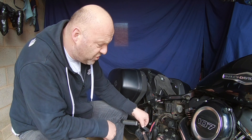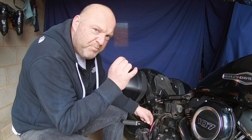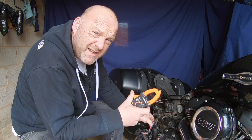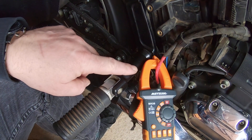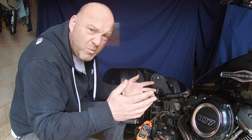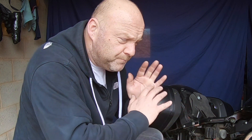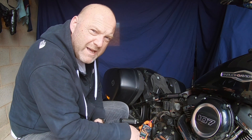As you can see I've unwrapped the sheathing and exposed the red wire. Be very careful — just feel where the wires are, make a very small incision and then try to unwind it. There are a couple of other small wires here so you don't want to nick those. Now get your clamp meter, separate the positive wire from the rest, and slip the positive wire through. To achieve 13 volts it really depends on what bike you have, so I can't give you a specific RPM — just use a multimeter across the battery and that will determine it. For all the battery voltage tests, watch that other video. On the website, on the Harley Parley page, there is a free PDF download of all the electrical figures you need. I'm going to set this on 400 amps max in case it peaks over 40 amps, and then if it's a lot less I'll put it down to 40 amps so it's easier to read.